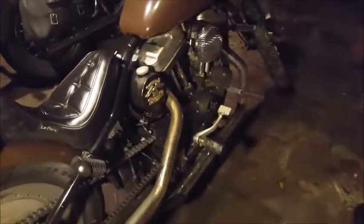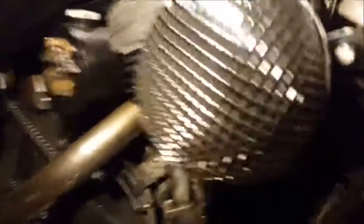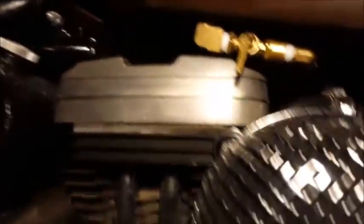Okay, not bad I suppose. I don't guess I'm out of the woods yet, but I've come pretty close to where it needs to be. As far as the air cleaner, again I like the design — it air flows through it a lot better I believe. Still not a big fan of that breather bolt scenario right there. I've got a little bit of oil happening right there — no doubt it came out of that. There are brand new gaskets on these rocker boxes, so it's not them. I guess I'll have to live with that.